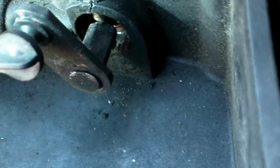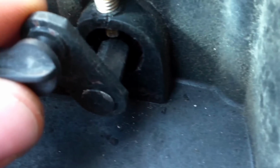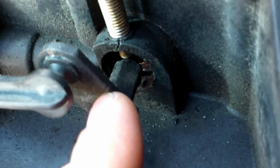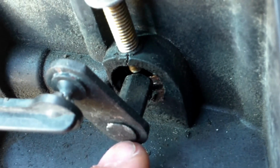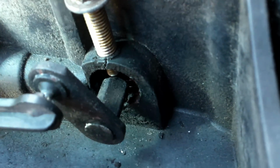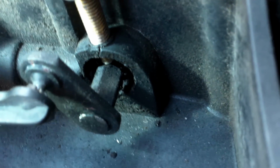Now you guys see, once we put that screw there, the way this works is there's plastic right here, but then that gap that I showed you is in between the screw and the part that goes through the bearing, the really small bearing, which is thick like this beginning part as well, so it seals right on the bearing. The part that's shiny that I showed you guys, where the original pin should lock, is in between the screw, which now doesn't allow the longer rod to move forward at all. That is the entire issue, because when it moves forward, that metal piece in between this plastic piece is where the bearing is, and the bearing size is bigger than that, which causes space for air to get in, and that's where the entire issue happens.